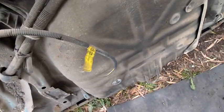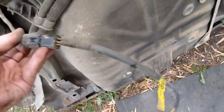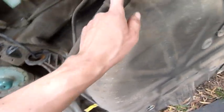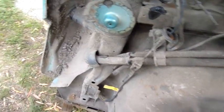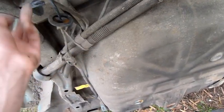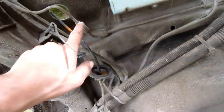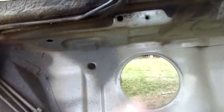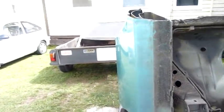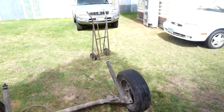Back there, that went to fuel tank, I think. Yeah, fuel pump and everything was on the other end of this. That went to carbon canister, that's filler, that's breather, that's fuel something. No, that's carbon canister, that one, and vacuum or whatever that is. I think that's just vents to in there, just atmosphere. The others are fuel, and the two small ones are brake lines. So you've got brake line, I'll grab that rigid line because it's got a coupling and another fitting on it. That one there is not, it's severed, so I'll leave that. Yeah, easy enough. Just got to sort of get one corner up onto the trailer and shove it on there. It's not extremely heavy.